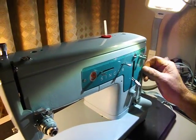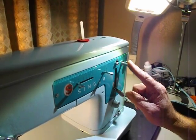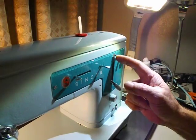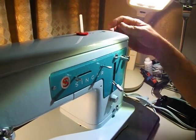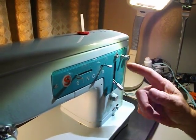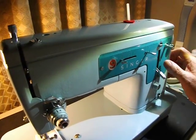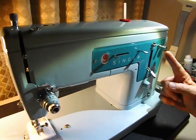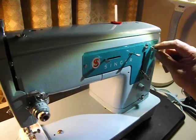This is the bobbin winding area, with a bobbin fill stop — just a little lever to move the winding mechanism over when you have your bobbin on there. What that's doing is putting a bobbin winder tire against the inside of the big wheel, so when the wheel turns, this spins and winds the bobbin. There's a screw you can loosen to adjust how full you want the bobbin. As the bobbin fills, the thread will push against the stop, the winder will move away from the wheel, and stop winding.